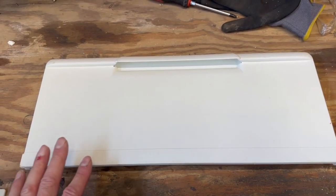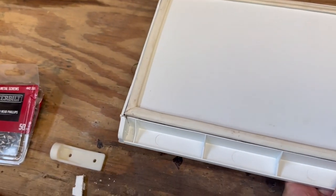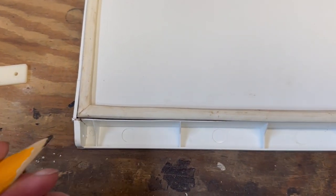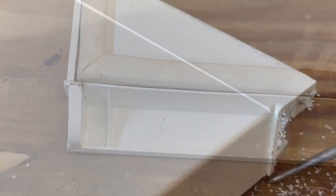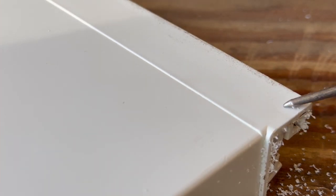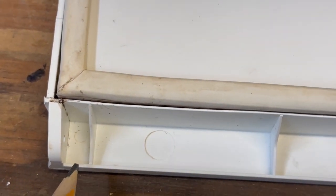This is the front side or outer side of your freezer door, and you want to preserve this trim plastic here. When we flip the door over we can see that the hinge plate will go in this position. What we need to do is remove the broken plastic part but preserve this thin piece of plastic — you want to leave some plastic on because this is the visible front of your fridge door and it's going to look aesthetically more pleasing if you leave this outer portion on. We also want to preserve this thin piece of plastic.